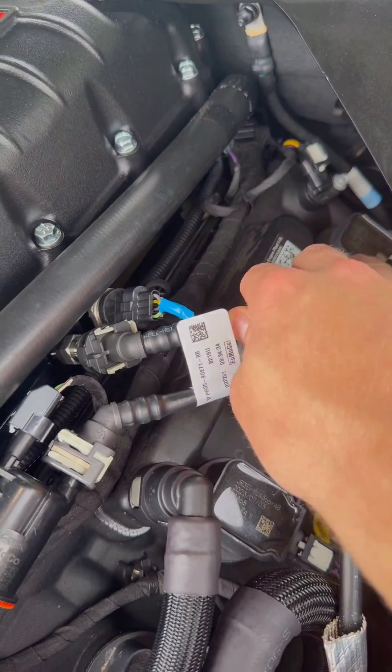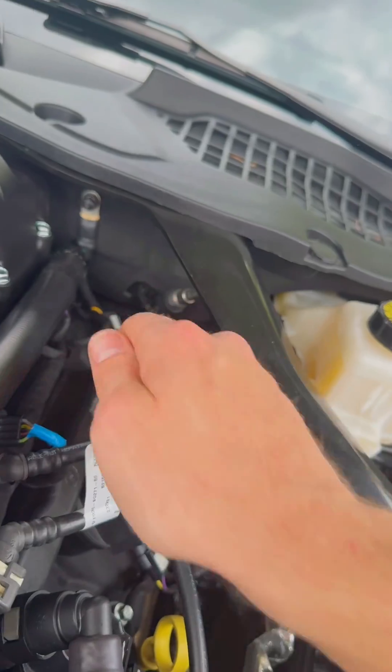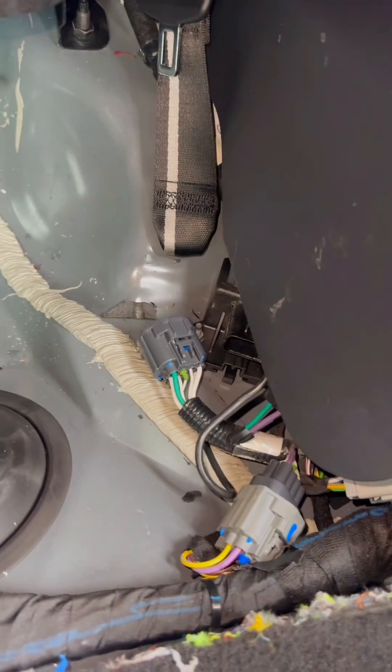On the driver's side is actually the fuel line. It goes into the fuel rail right there and then back into the firewall over there. We're gonna have to disconnect it. Also, if you guys don't want to get squirted with fuel, unplug this from the fuel pump right there, let the car idle until it dies off, and then no fuel will be in the lines.